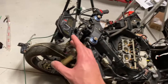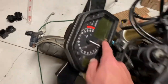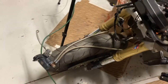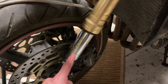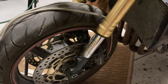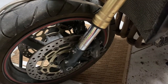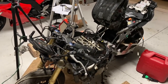I still have to swap out this fairing stay — I've got a brand new one. I've got a new cover for the gauge cluster. I'm not changing the gauge cluster, but we're going to get that spider out of there and replace this clear portion here that was scratched during the accident. I'm also going to be removing the front brakes and prepping this thing to have the forks removed. I'm going to try to get some quotes for replating. If I can't get it replated, I may have to go through the process of replacing the entire tube — we'll see if that's cheaper than buying a whole new set of forks. I'm hoping we can just get it replated for a reasonable price. I've also got the seal kit and the bushing kit for the forks. It's about 10:30 p.m., so I might work into the wee hours of the morning.